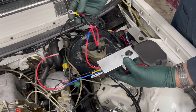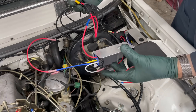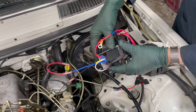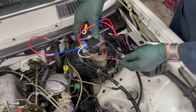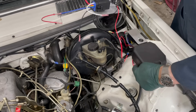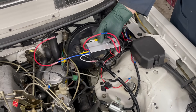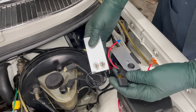When I was putting the prototype together, I said why not offer this as a plug and play? You're only going to have to drill a couple of holes and make a few connections, and you'll have this running in your car probably within an hour to an hour and a half. This lead goes over to the battery or your main bus - it's fused, comes into the relay, which is powered by a connection into the fuse box. All this is wired for you with instructions.